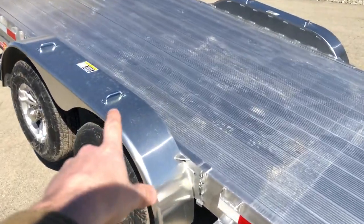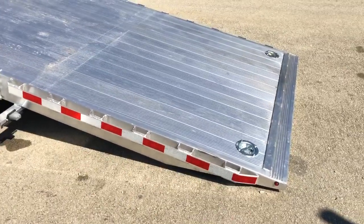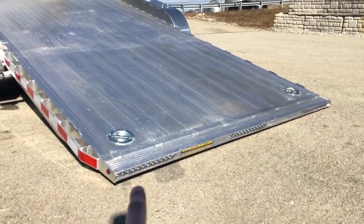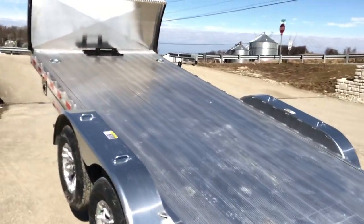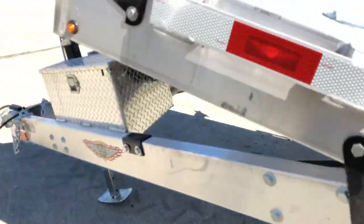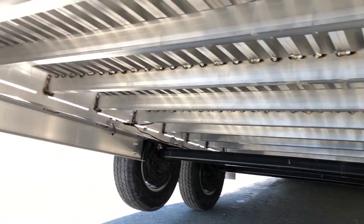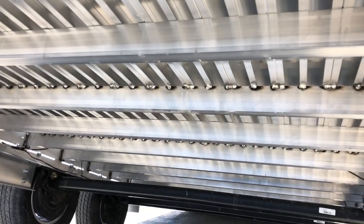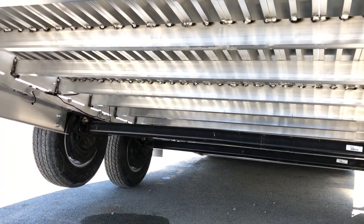They also put handles on the fenders, which are nice, and then a backer as well. So again, stake pocket and rub rail for tie-downs, and we've added the swivel D-rings for extra tie-down ability. One thing I've always liked about H&H aluminums on the tilts is they do the slimline LED clear lens — gives it a very nice look. Looking at the heavy-duty features underneath, most manufacturers when they do extruded aluminum have no cross-members, but this one has cross-members running roughly on a 14-inch center. Most would just take the extruded 2-inch junior I-beams and run them perpendicular, but H&H runs a full cross-member plus the extruded planking. Pretty tough trailer for a 10K.